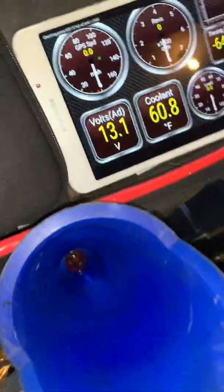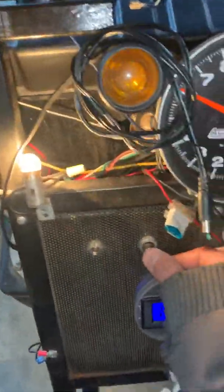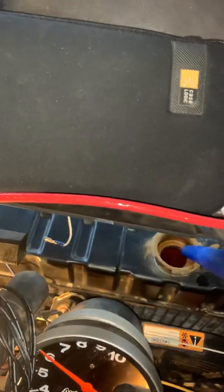Let's see if this thing fires up — everything's plugged in, the only thing I'm not using is the OBD2 connection. I've got two brand new O2 sensors wired in. This harness came with a fuel pump relay, let me hook that back in. My ignition's on, let me check the antifreeze real quick. The first time I fired it with the other system the thermostat opened and it sucked itself down, so I'm leaving this open and a little low so when it expands it doesn't come out the top.